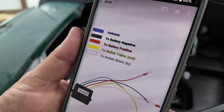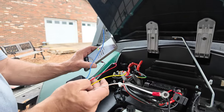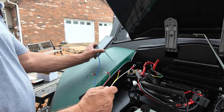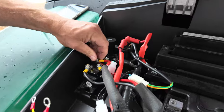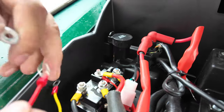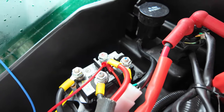The picture that comes on Amazon is the one you need — it's the actual right reference. So the white wire goes to the in and the yellow wire goes to the out — those are the two you're connecting to your wiring harness. These two other wires provide the power to the system. I've already loosened this up; it will go to your red wire right here. This provides the power to the remote system — go ahead and tighten that down.